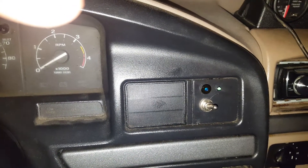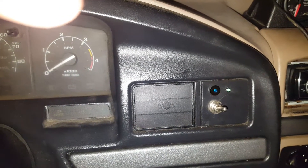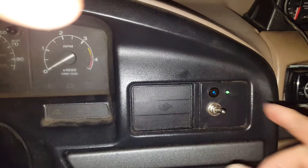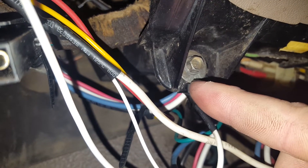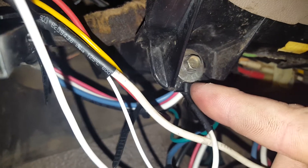It's actually pretty simple to hook up. Basically what you do is drill your 5/32nd hole, push it through, and then hook one wire to your ground — my ground is down here, right there. It goes right to the frame of the dash which hooks in everywhere else. You can see I've used it for a couple grounds and other stuff. I'll show you where on the truck, on the glow plugs, where it hooks in. It's pretty easy.